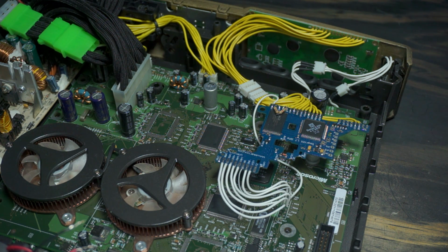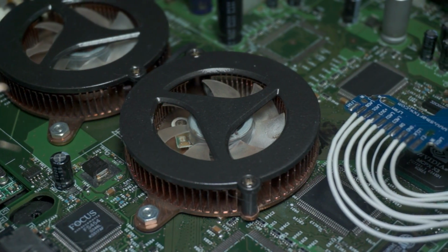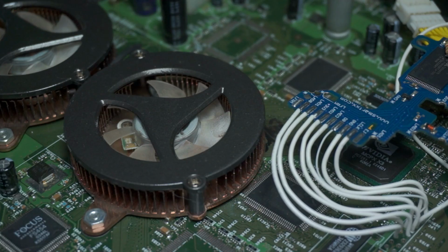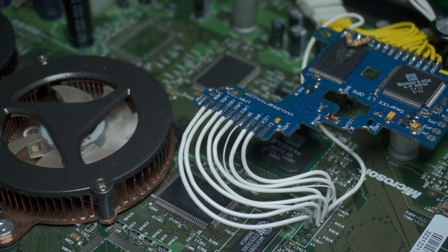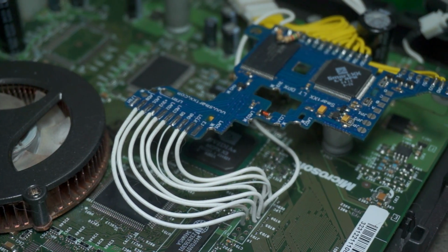Originally, I had 23 hardwired wires that held the motherboard to the front faceplate. As you can imagine, taking it apart sucked. So the mod chip is a SmartXX LT OPX. Again, a big shout out to PolyT for sending it my way. I really appreciated it. The chip was wire installed with 26 gauge wire. The D0 point is 30 gauge, and I really just tried my best to make it look as clean as possible. The white wires all just have a nice flow to them.